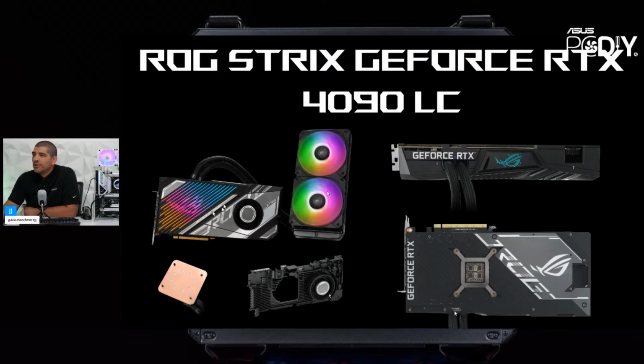And you still do have the dual VBIOS design, which means you have a quiet mode and you have a performance mode. It's up to you as far as choosing them. Effectively, the performance is almost about parity between the two. It changes a little bit of the fan profile. So if you're looking for a quieter experience, maybe you've got your system closer to you like here, then maybe you want to run the quiet profile. If you've got it a little bit further away, or maybe you game with headphones and you won't notice a little bit of the ramp that increases between performance and quiet mode, then you can use the P mode. But ultimately the choice is yours.